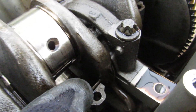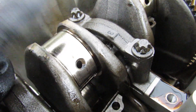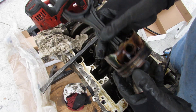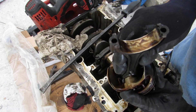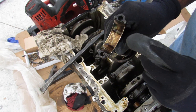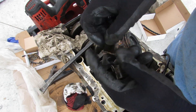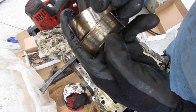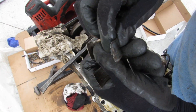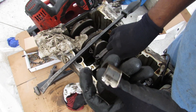The bearing that was supposed to be on top has actually spun around and gone to the bottom, while the other bearing from the connecting rod side is still on the connecting rod — this is what you call a spun bearing. That leaves you with a gap on top, and as the engine is running it's going to knock because that gap has to be filled. I'm going to remove this piston. You can see how black it is just from the heat — this is because of a lack of oil. When the oil pan busted a hole, the engine ran out of oil and things started to overheat. Looking at the actual bearings, the surfaces are really scored up and the shapes are feathered out from all that heat — they just could not take the forces of the connecting rod rotating on the crankshaft. They've squished outward and formed a ridge.